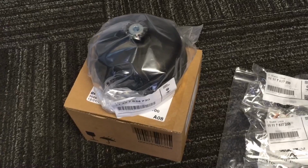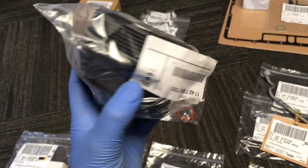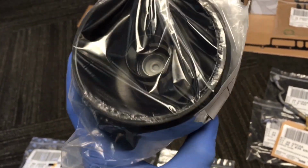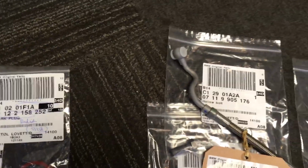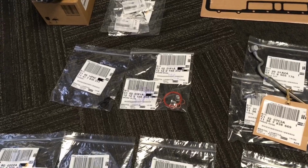This is the new style piston squirters. And then also an option to change, for relatively small money, the oil filter housing, because on the V10 it sits upside down. So whenever you get any sort of bearing material or debris, it always collects in the bottom on the V10. So for about another £35, it's always good to change that to save any particles being stuck anywhere in that system. Then this customer is also specifying a dual drained sump.